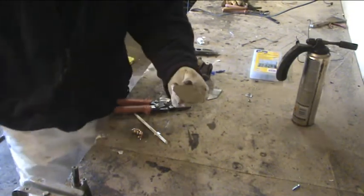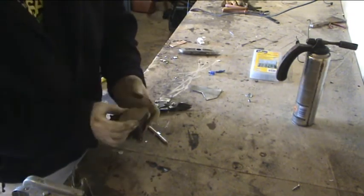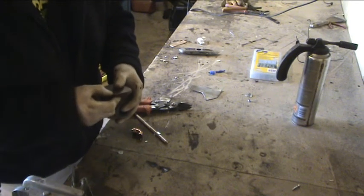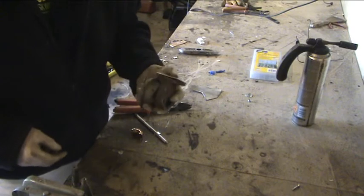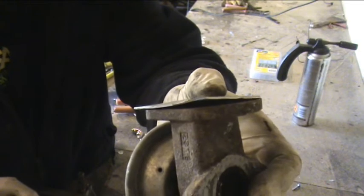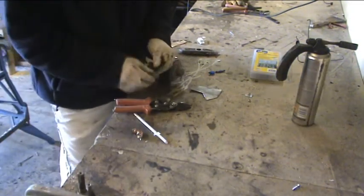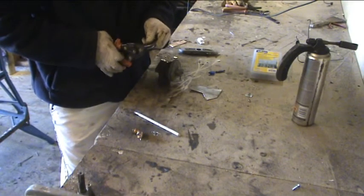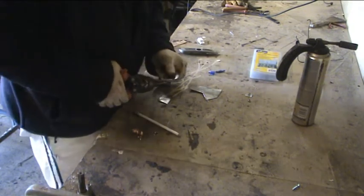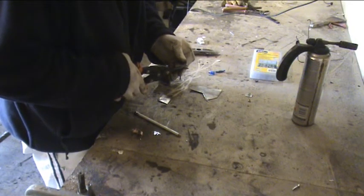And that's what we're left with, really. A little bit of steel. Hopefully that should go on there, make a little blanking plate. Now there's something you need to remember. You've got to make sure that's flat, because if that's not flat, as you can see, we're going to get some gaps in there, so we need to make sure we've got good gaskets and so forth on there. I'm just going to trim this last bit, because you guarantee it's going to be me that's got my hand under there next time when we do any other jobs.